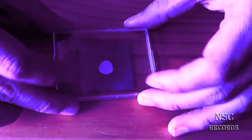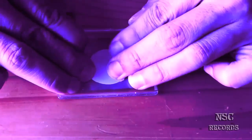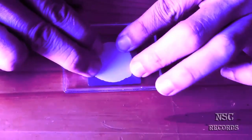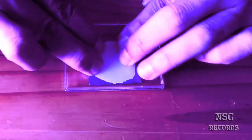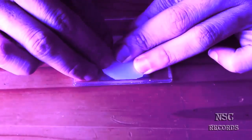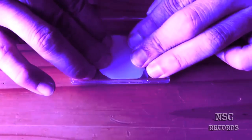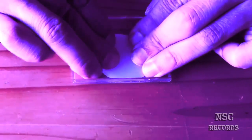Okay, so let's test this now. And here we go. So watch this, okay? Now we have the first problem. I'm pressing a lot down, and you can already see the air bubbles. Oh, air bubbles on the P method! I'm pressing so much down, and you can see that these places here are missing, because the heat spreaders are not perfect. That's why we sometimes lap, you can lap the CPU. I press with a lot of power, and now I will release the pressure and you will see the air bubbles coming, okay? Are you ready, guys?